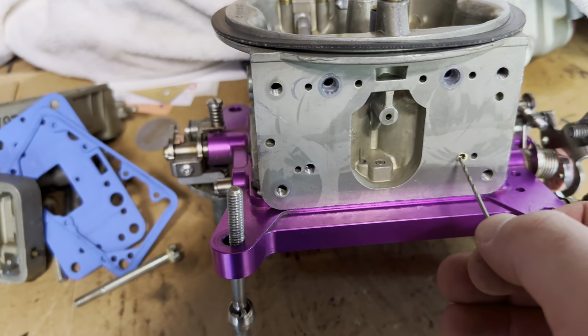People get just a wee bit too anal. Here's more proof that these blue gaskets are really great, and the phenolic spacer works wonderfully — the phenolic spacer allows me to use these gaskets over and over again. I referred back to my notes and totally forgot that I put transfer slot restrictors in this. I had to whittle them down to 69 thousandths in the primaries and the secondaries. Right now I'm just doing a set for the primary side, even though I took them both apart — really because I'm lazy.